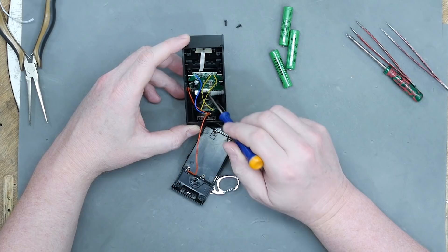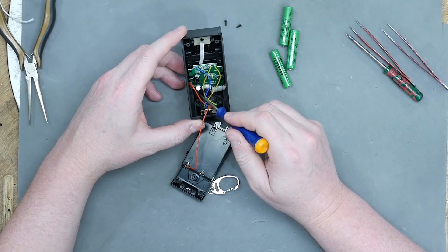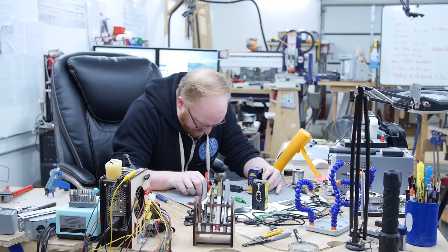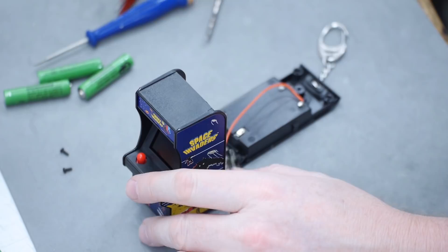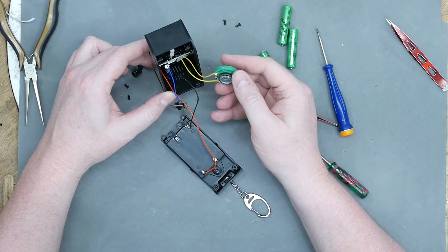SDA — that means serial data. Looks like they have a not-populated surface mount capacitor and some through-hole capacitors in its place. Everything is screwed in place — you've got a power switch screwed in place, and even the speaker is screwed in place. The speaker holder and the power switch holder look to be cut of the same cloth — this sub-assembly holds the power switch and speaker in place. That's pretty efficient. This is the exact same speaker that was in the Oregon Trail game — I can tell by its weird green color and excess of holes.